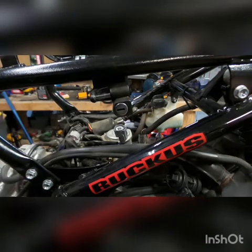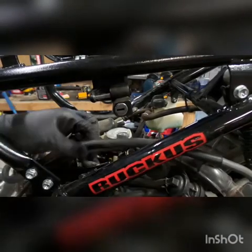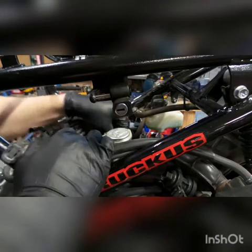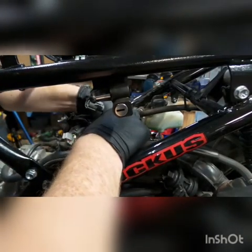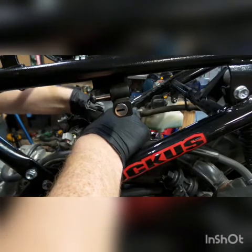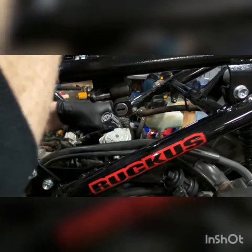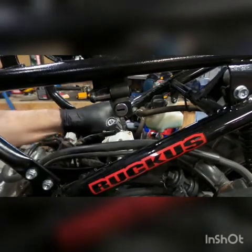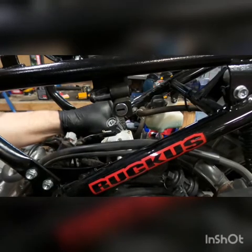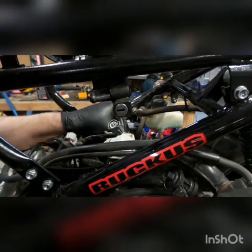Since this bike is losing the airbox, I'm going to pull the airbox completely out of the way — normally you wouldn't need to do that at all. You also have your fuel line on one side. Make sure you gently pull that off, because if you're pulling really hard it's actually going to rip instead of pull out. This one's never been off, so if you're not super careful it definitely could rip — not the biggest deal, but then you have to replace your fuel line.